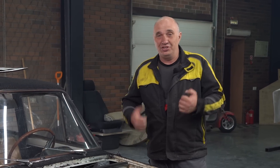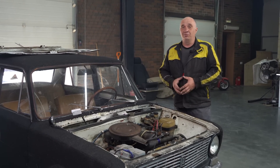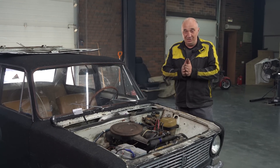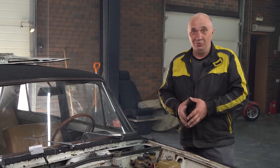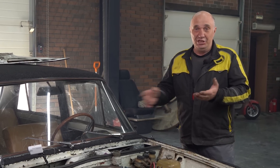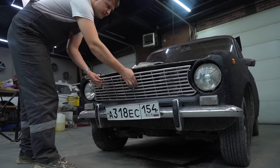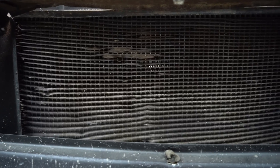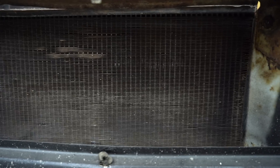But the shroud is not the only thing that can cause you trouble. Modern cars usually have electric cooling fans — the computer triggers them when it deems necessary — and you usually have two of them. Now imagine you're at the shop, they move the primary radiator away from the AC heat exchanger, and in between them you might find a very unpleasant surprise: basically a wall in there consisting of fluff and dirt. So here's what we'll try: we're going to simulate a clogged radiator scenario, and while we're at it, we'll put the shroud back in to get everything more or less back to factory spec.